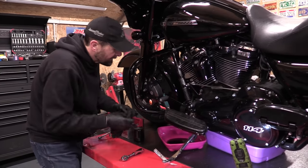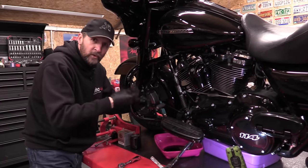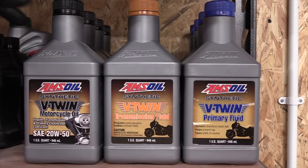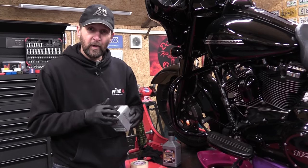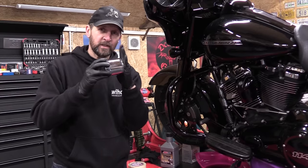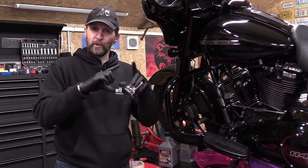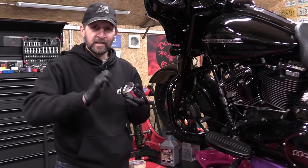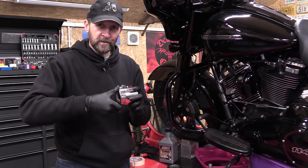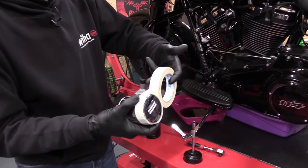Pull out your cellophane, then clean the seat that the filter screws up against — there's a shiny silver ring; make sure there's no debris or old oil on it. Give it a good cleanup and you're ready to install the new filter. A helpful trick: half-fill the new filter with oil and wet the seal before screwing it into the engine. When the rubber seal touches the engine, from that point turn it half to three-quarters of a turn further — that's the advice in your manual. Do it by hand; don't use a tool, as it's easy to over-tighten it, which gives the next person a nightmare getting it off.